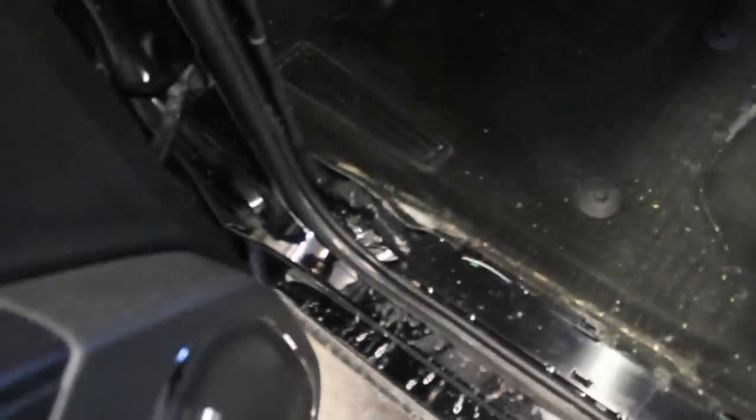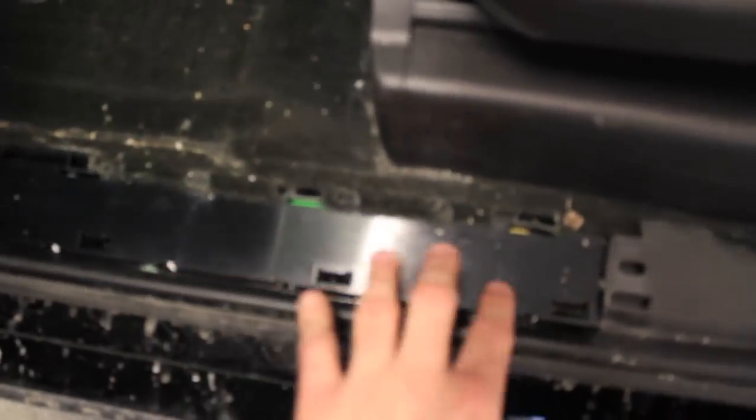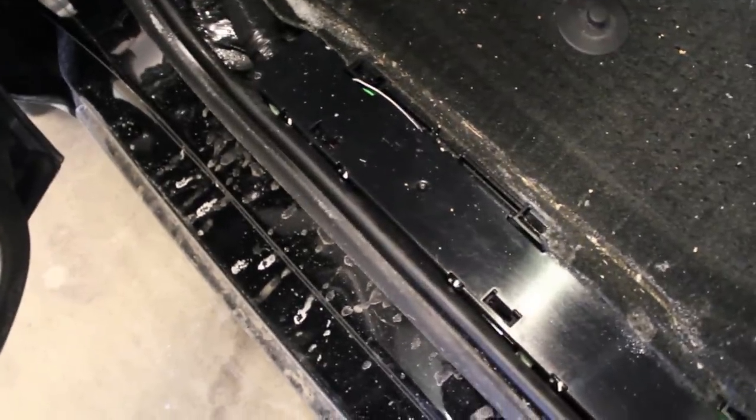Run the wire up along the side of the truck. I've already got the kick panel removed, which is along the driver's side door, and there's another panel on top that hides the wiring. There are a bunch of wires behind there, so you want to remove that as well. It's held on with little clips — not even clips, it kind of has a lip. You might need a screwdriver to pry it, but it's not difficult.